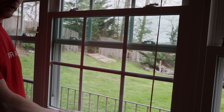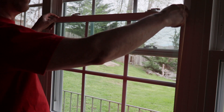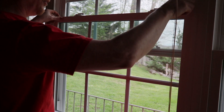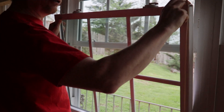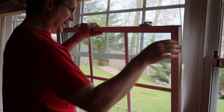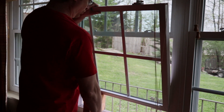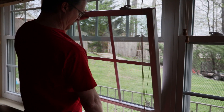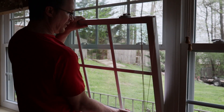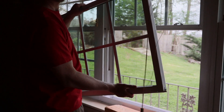I've got my piece of wood holding the window up. All you do is grab these two tabs, push them in towards each other, and the window will come right out just like this. Be very careful that the piece of wood doesn't fall down. Pull the piece of wood out, angle the window a little bit, and the window will come right out.